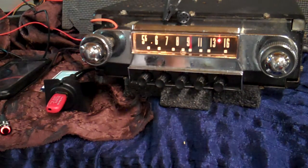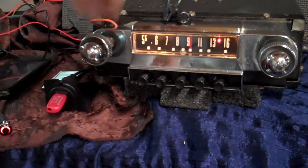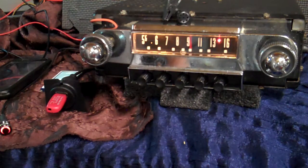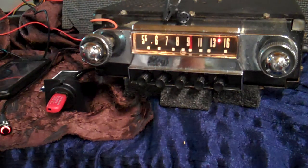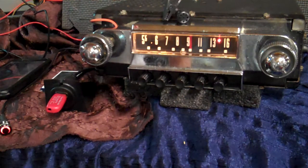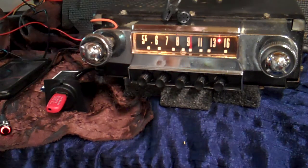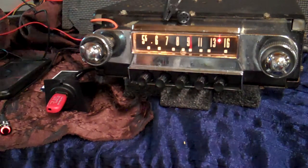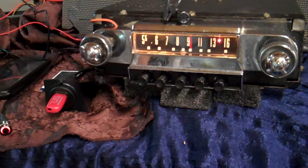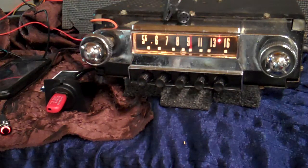We've done a full Aurora Design version on it, polished all the chrome and the push button. Went through the tuner and put the Aurora Design conversion in it. It now has AM/FM stereo, four channels out, 45 watts a channel. It has five preouts on it in case you want to add an amp to your speakers, or even an amp and a sub. It has an auxiliary in, sitting there listening for a device to come into it, so you can plug anything in.